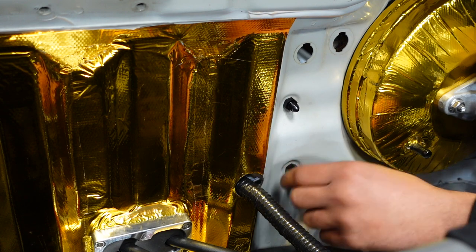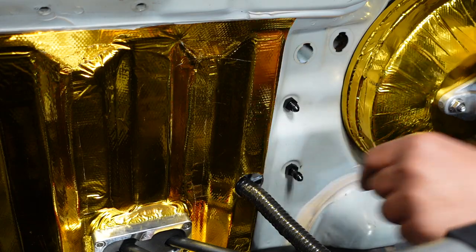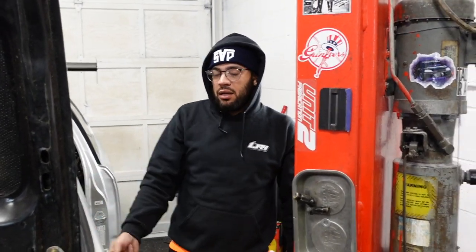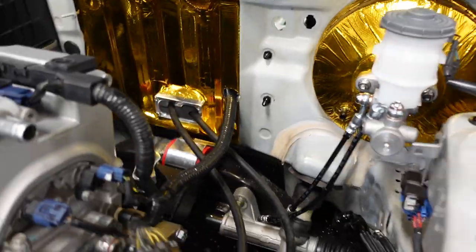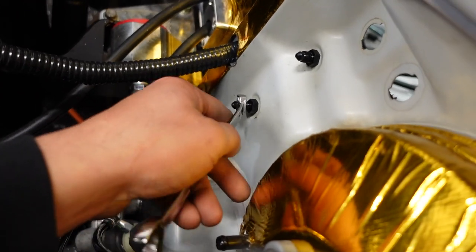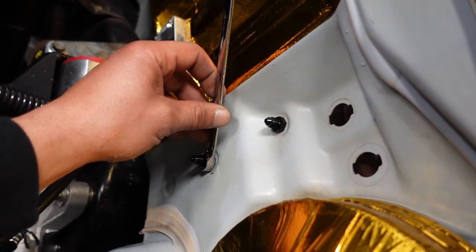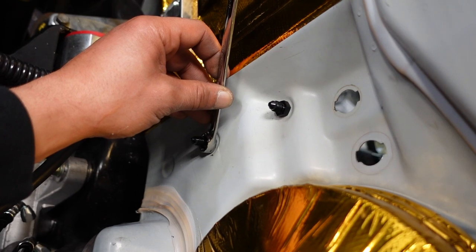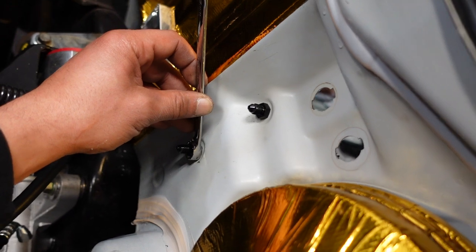Okay. So inside there, your T, right? Yeah, because the front doesn't go through the proportion valve. So the front just gets T. Trap, this battery's going to die. This is crazy, bro. I'll be right back, guys. Okay, our bulkheads are in. You need me to hold the bottom one? So bulkheads are into the firewall. Nice and clean. Again, it's a 13 mil on each side. And we're just tightening.